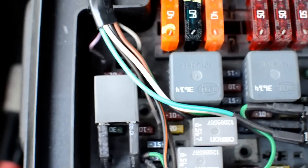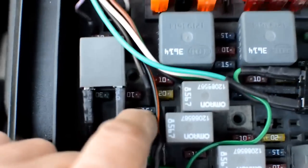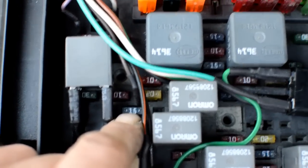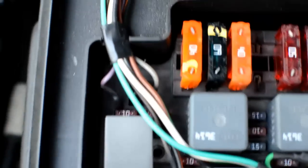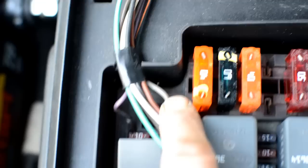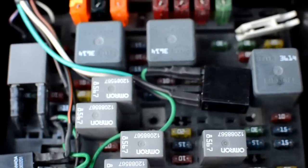And right in here, I'll show this better on the schematic inside. I've tapped into my trailer fuse for my parking lamps and my trailer right and left blinkers for my blinkers on the plow. And yeah, let's explain this.